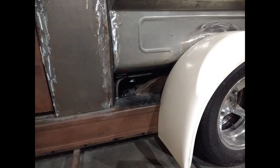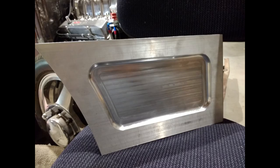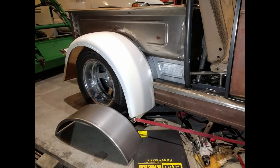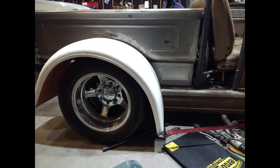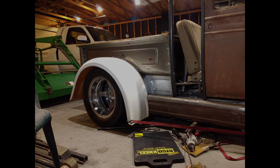There was a big hole in the side of my bed that I needed to figure out how to pretty up. So I made a panel on my mill and milled an indent into the panel that kind of matches the reveal on my bed sides. Then I took another piece of trailer fender and put it in there to fill in the rest of the hole, and bolted the panel up to it. It'll all be painted when it's done. That pretty much finished up my summer on this project — see you next year.